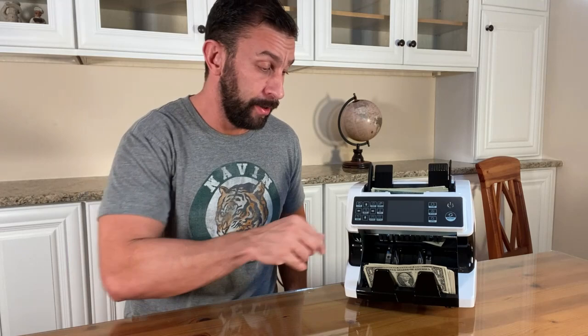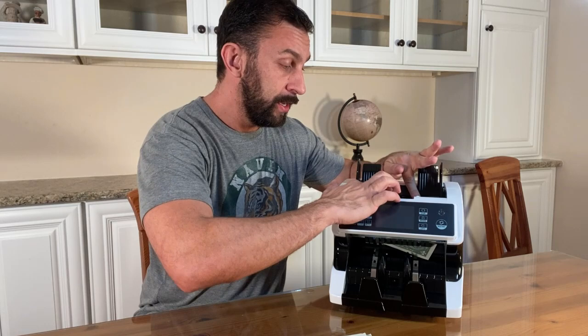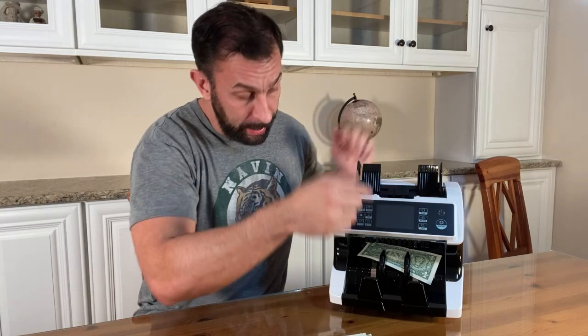I'm here to help troubleshoot your bill counter. If a bill gets stuck, the first thing you're going to do is take your bills out of the stack, out of the hopper, and clean it out of bills. Then turn it around and turn off the power right there — turn it to the off position. You can also unplug it if you feel safer doing it that way. Make sure it's completely powered off, then rotate right here by hand. When the bill is able to grab it, pull it out the bottom, and now your bills are unjammed.